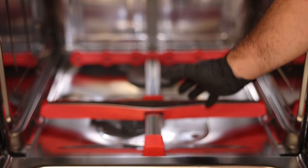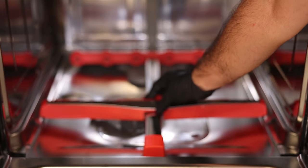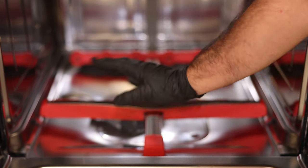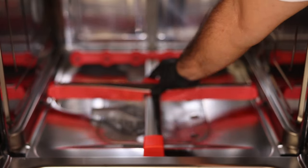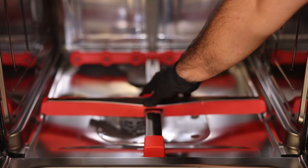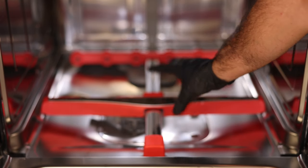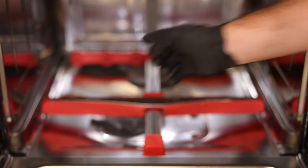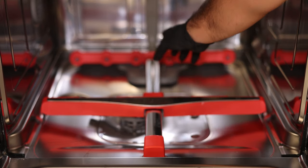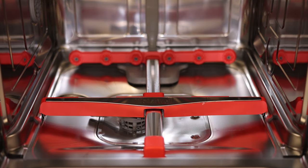The water wall system is a little different from a generic dishwasher — it has a motorized arm and a belt-driven spray arm. When it goes forward and back there's a louder noise than it should be, and the owners mentioned the spray arm sometimes gets stuck in the same position and stops moving back and forth. The motor assembly is in this compartment back here, and it's sold in two different configurations: just the motor itself, or the entire casing with all the tubing included.